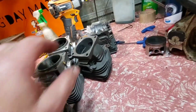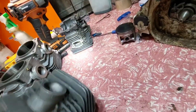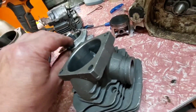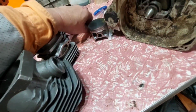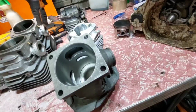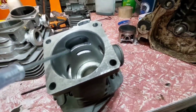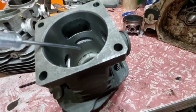Not everything's the same. So maybe, for example, what's this? This big bore kit too. That's big bore. No, that's 60. If you look at the way these are designed, and I've seen better ones than this recently, but you can't buy them, though I've got one. Set up properly, because I didn't know about this, I only recently saw it, seen it on the G288. If you look at the lower transfers there, on a good cylinder, you see it's fatter here, and the air will flow that way and flow back around the fat part there and direct the flow of air back towards the cubby.